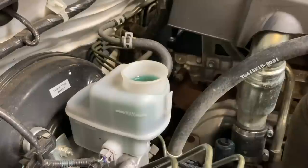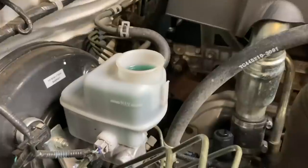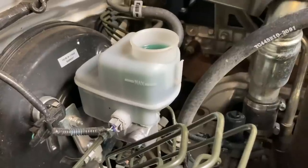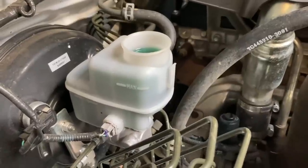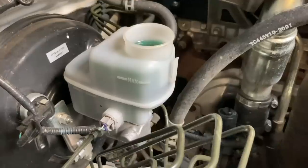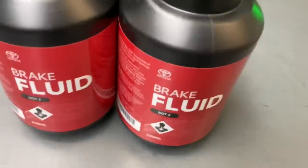I'll say 'about' just to cover myself — but exactly 100, depending on your thermometer. So what happens is, if brake fluid is hygroscopic and absorbs moisture, that means over time its boiling point reduces because it's going back towards being water. Nothing's sealed 100%. That's why it's important to use sealed containers when changing the brake fluid. That's why it costs a bit more, but we use the 500ml bottles of Toyota brake fluid. It costs more, but you get a quality job — you know it's a sealed container.